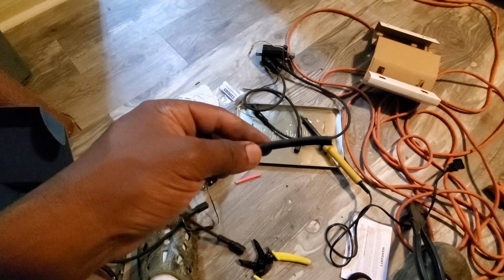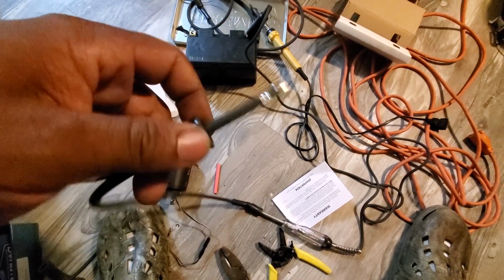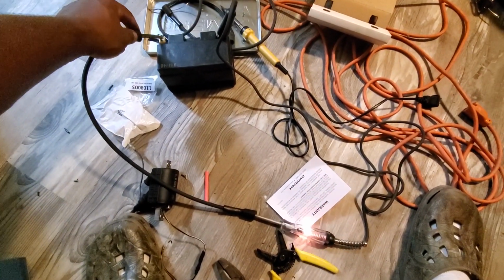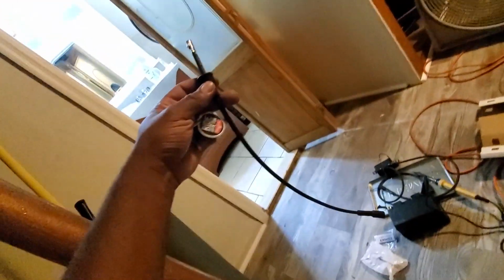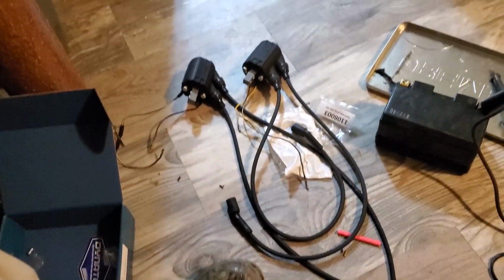The spark plug cables are not pre-cut or ended, so you have to do that yourself. I tested the continuity of each lead when I made it by making them part of a circuit with my test light. Once the new high output coil setups were installed, the difference was immediately apparent due to the stronger spark.